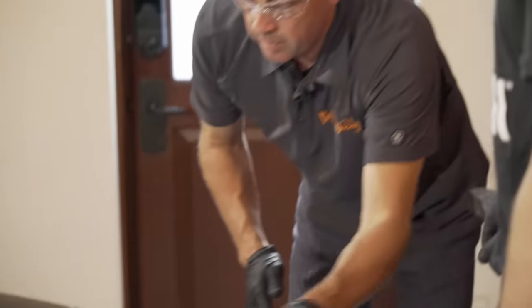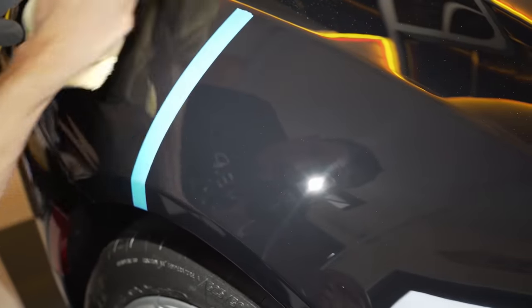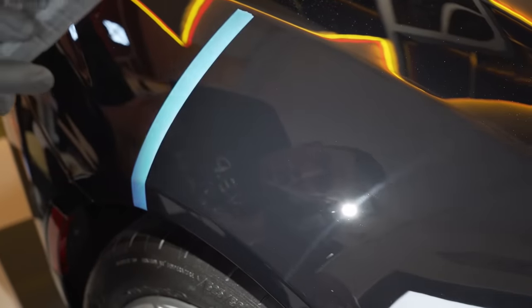This can be a healthy indicator that we haven't overloaded the pad with extra residue, which would cause us to re-scour the paint and then start over again. So it's easy to chase your tail if these methodologies are not recognized and practiced on these finicky paints. And once in a while you'll get everything looking flawless, but there might be one little pigtail mark or one little section, and then we can focus on that.